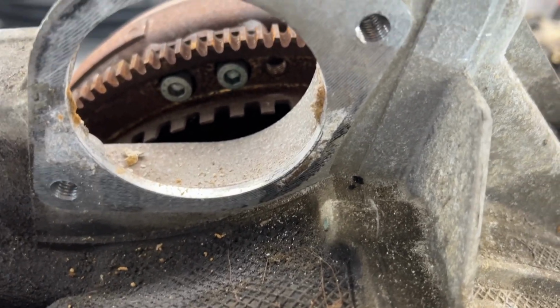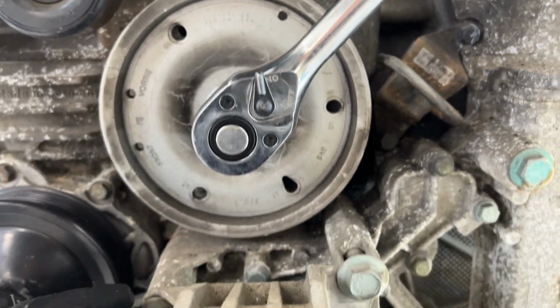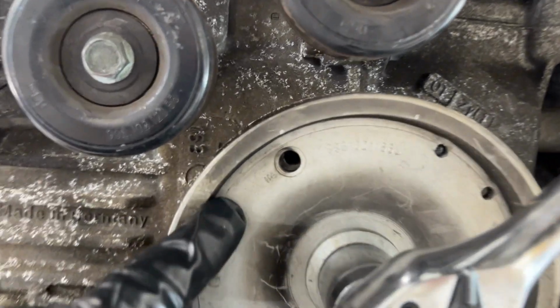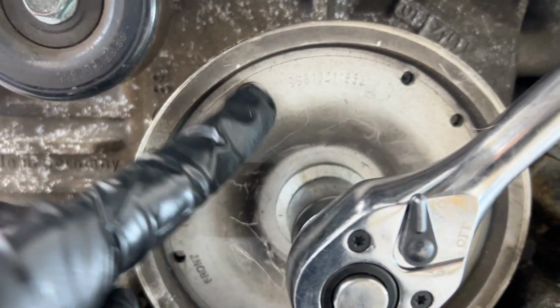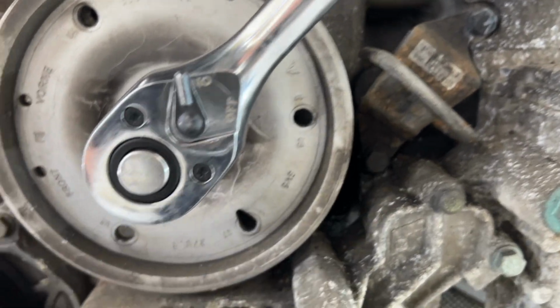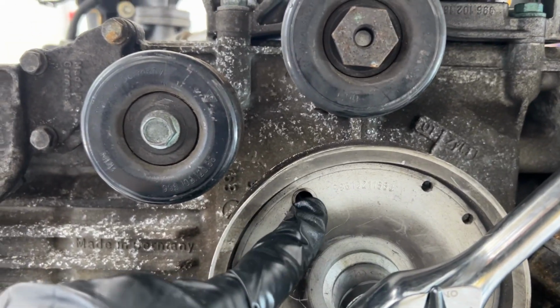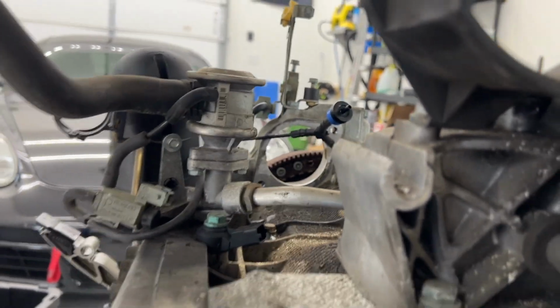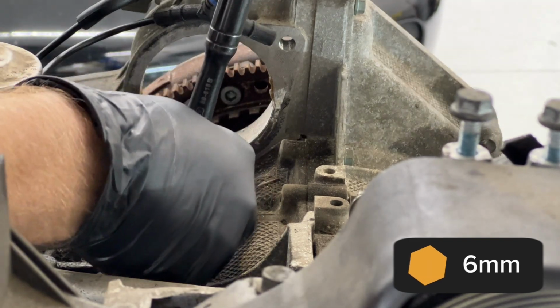and see the bolts that we have to undo to get this torque converter off. And as I had assumed and been told, this is super cool. The teardrop shaped one, that's your top dead center where you put the pin in here. But look, when those are lined up over there, this is lined up right here, and there are 3 of these holes. So the 3 non-teardrop holes, the big ones, you can put the pin in and rotate this to know that it's going to be exposing those bolts. So very awesome. All right, so it looks like these are 6mm hex.